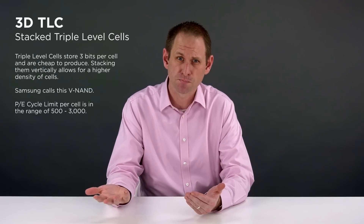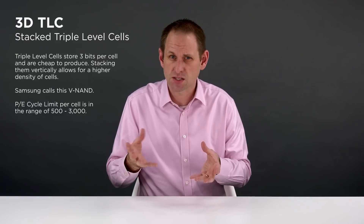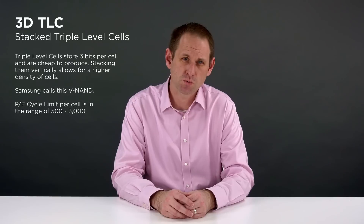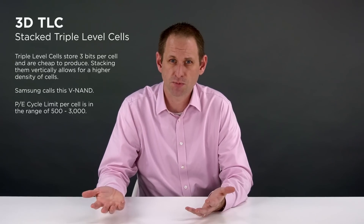So let's take a look at one of the better consumer SSDs on the general market, the Samsung 970 Evo Plus, and we'll assume that Apple's drive offers a similar performance. I think this is a fair comparison because Apple SSDs appear to be of very good quality. The 970 Evo uses 3D TLC cells, and with this type of cell you can typically expect a P/E cycle limit of between 500 and 3,000. The lower end is for consumer products with shorter warranties, and the higher end for enterprise or industrial grade. The 970 Evo is not enterprise grade, but it's not entry-level consumer either — and I suspect you could say the same of the SSD in Apple's M1.